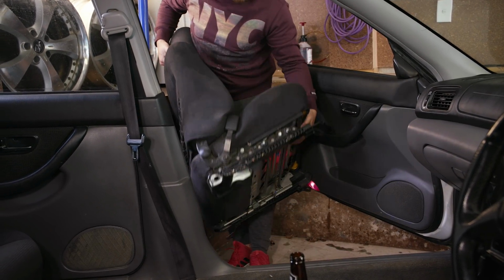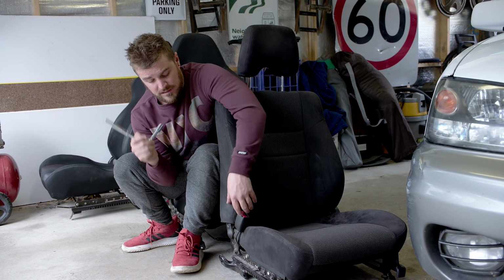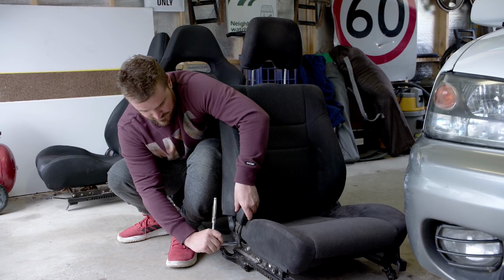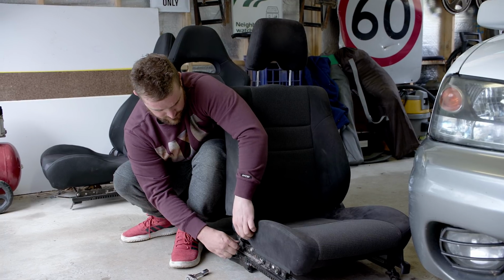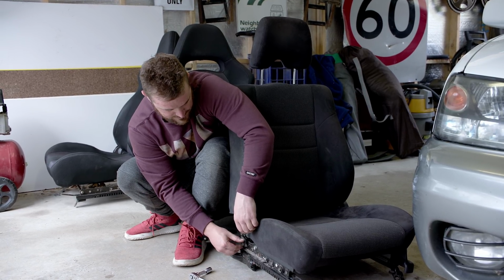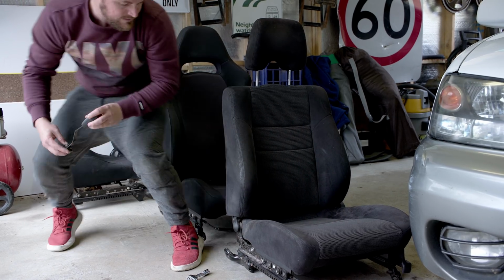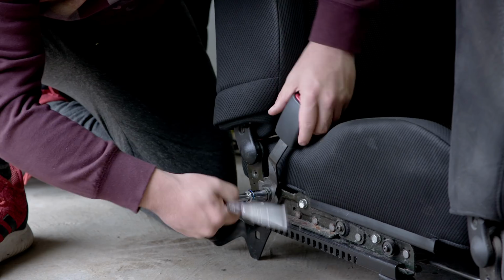More human slime. So here's a step most of you won't have to do at home. Now because these seats that I've bought didn't come with the seatbelt clicker-a-doos, what I'm going to do is just undo them from there. Same 14mm spanner or socket or ratchet or whatever you want to call it that you used before. Keep everything in order and just transfer it straight back across.